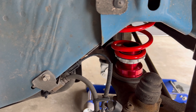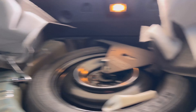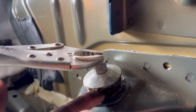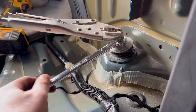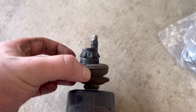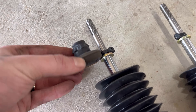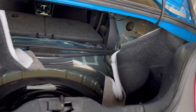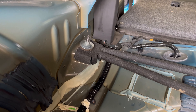Before I get too far, I want to show you this. As you guys can see, the perch sits on the bottom to make it super easy to adjust ride height. However, for these, I'm having a difficult time getting these off. This top piece here kept spinning on me when I spin this nut, so I have to use vice clamps and a wrench. I just wanted to show you guys that this is the setup you might have to do — it all just wants to spin together. On top of these, the hardware sits here. You keep this factory hardware. You'll take this off and these will just slide back over the top there. That goes back in — helps prevent any type of noise. Just cut those zip ties and those go back over and sit on the washer.